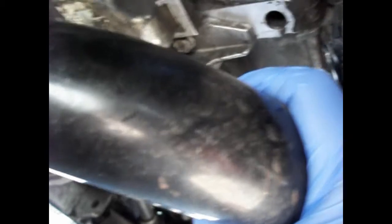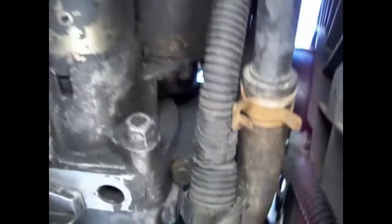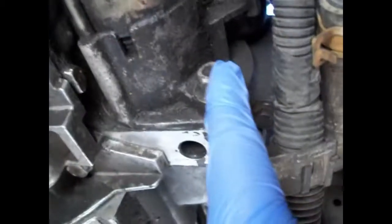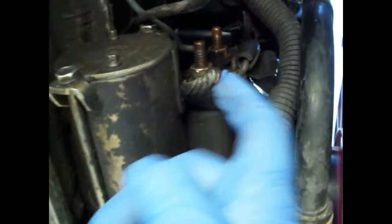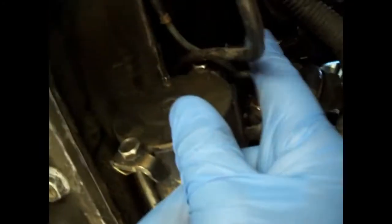Underneath the car — don't mind the black pipe, that's part of the turbo setup; your car won't have this. Here's the subframe I was speaking about for jacking. In reference, here is the starter, located between your radiator and your oil pan on the front end of the car. There are 15-millimeter bolts — one on the bottom and one on top. There are also a few electrical connections here that you'll want to get loose, but really we just need to worry about those two 15-millimeter bolts.